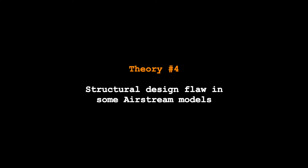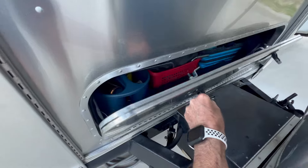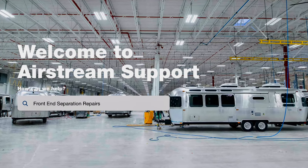The fourth theory is a poor design by Airstream when they started putting front storage bays in some of their models. The theory is that they had to cut out some of the structural integrity of the ribs that help attach the shell to the frame in order to put in that access door. It does make sense that if you reduce structural integrity you're going to potentially have problems with frame separation. I think Airstream has started to realize that, because they do make repairs and fixes, and I believe they've already started modifying some of the manufacturing process to make a more robust connection between the shell and the frame.